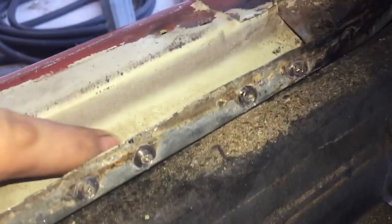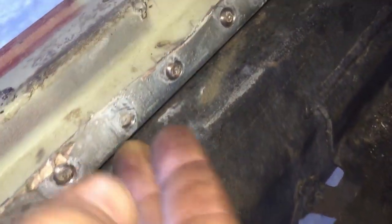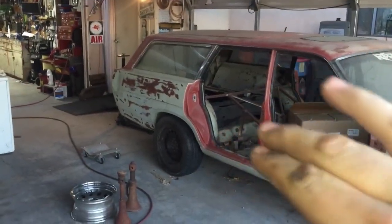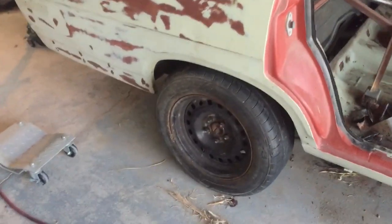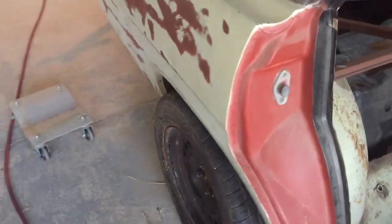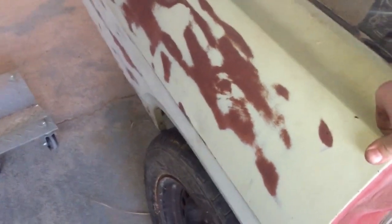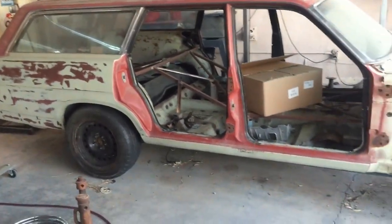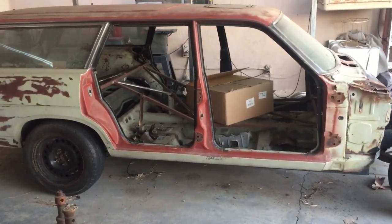I finished cutting out the driver's side in the front — a lot of this is still rough edges but you can barely see the frame — like right there that black line, and then up here you see it more. The fender is going to cover all that. Still looks like it's hitting a little bit right there — just lots of little tweaks. I need to test fit the tires in the back because these are a different offset than the stock Crown Vic wheels. I gotta throw those on and make sure they'll tuck in the fenders. Put the engine in too and see how it meets up against the firewall. I went ahead and sat it down to see what it looks like — the back is a little off center, it can definitely go towards the driver's side a little bit more. With the higher springs in the back, if I wanted to put on some lowering springs I would definitely need to do something with that fender. But you don't even really see the frame, and it's going to sit lower still.